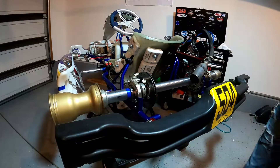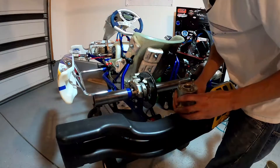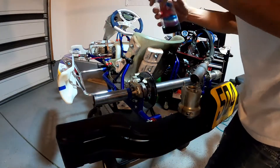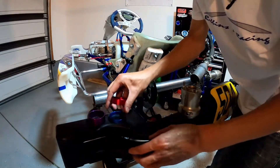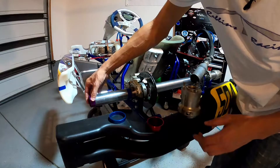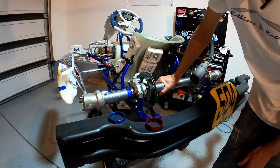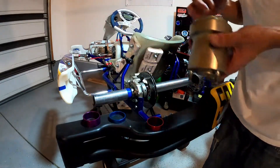To make this change, I pulled the wheel and hub off. I grabbed a pipe cutter and cut 5mm off both sides of my axle, then bought these spacers — they come in all different sizes. With my largest spacer in the hub and the cut axle, I know that's the widest track width I can run. It makes it real nice and easy to increase or decrease the width of my rear end.